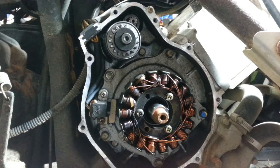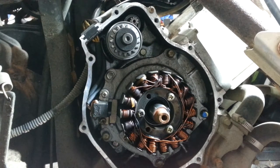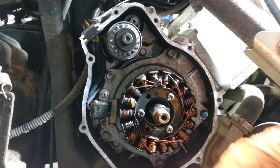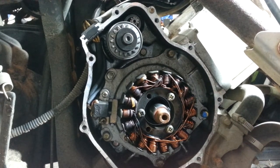This is a quick video: if you have a Polaris Sportsman 2004-2005 that's overcharging, take a look at your stator because you're probably going to have an issue with that. This is before you go spending $150 on a new ECM — check this out because there's a good chance your stator is broken.